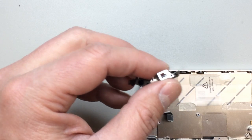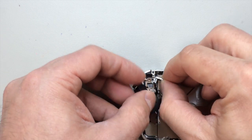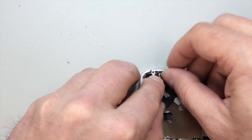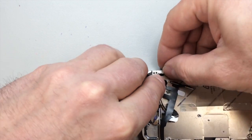And it looks like I had that in the wrong position. It wasn't lined up. So we want to have this facing towards the table, because that's the way that the switch in the phone is going to be. And by the way, if you happen to have had it fall out, the red stripe is going to be towards the front of the phone on that silent buzzer switch.